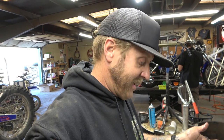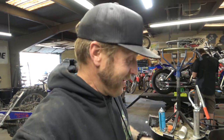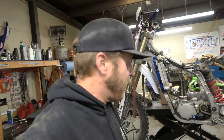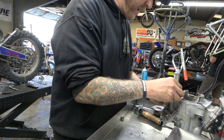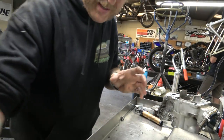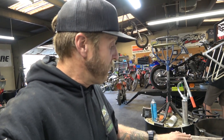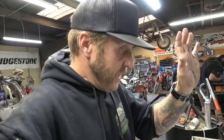I don't think I've ever had one clean up that quickly — maybe this cylinder or piston had way less time than I thought. Either way, now it's brand new. To start reassembly I like to clean up the base gasket surface using just a normal razor blade. The main thing is don't ding the surface and don't change the surface — so don't use a bunch of power tools. If I can do it with just a razor blade, I do.